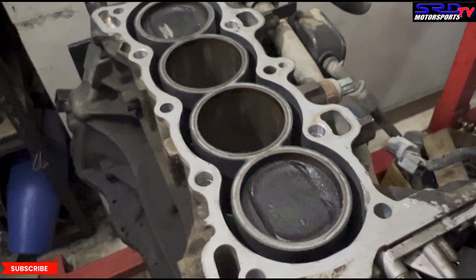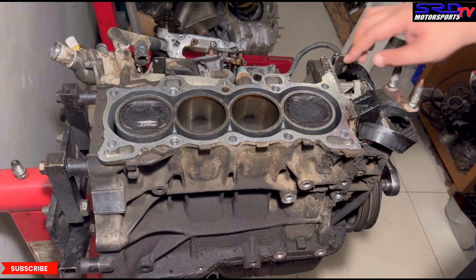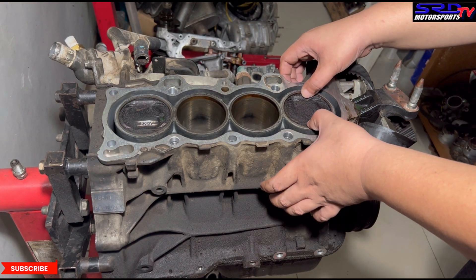Mechanics would say 'boss, may i log yung piston' — meaning the pistons rock at top dead center. Think about it: there's a thing called piston-to-wall clearance — of course it's going to move. They're just scamming people into pulling the engine, rebuilding it, and running even oversized piston rings — we'll get to that later. But remember, this is a 97,000 kilometer mileage motor.